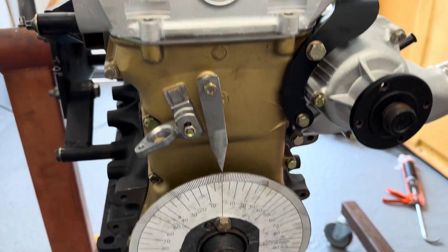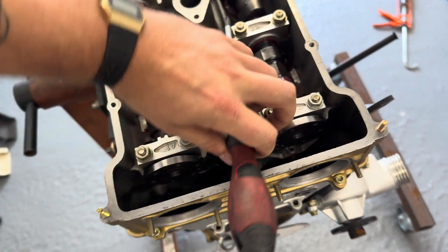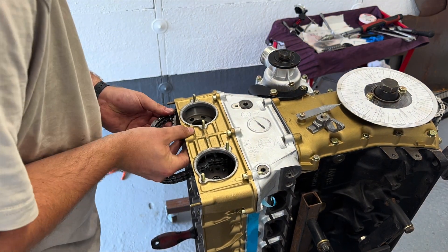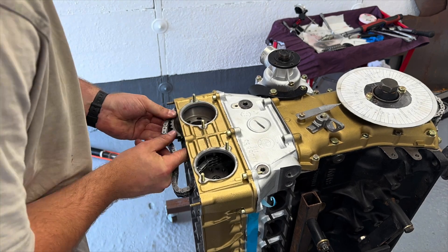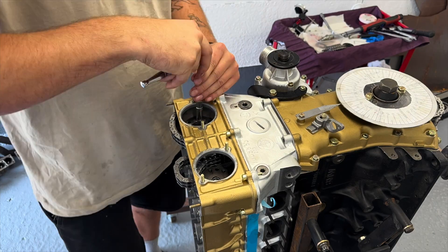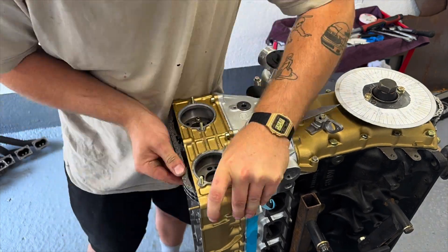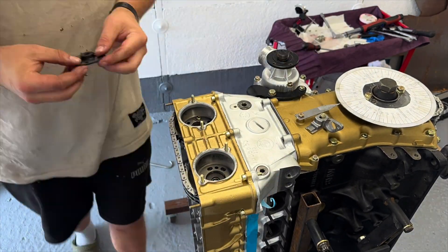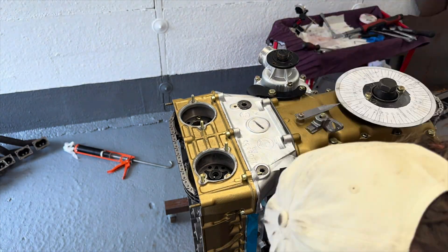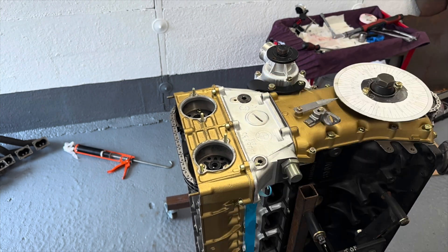When I was doing the PTV checks I did mark the cams in their top dead center position, so I put them back to where they were and then double checked the valve lift at TDC. The next task is to put the sprockets on — this is pretty tricky. You want to install the intake first while applying as much tension as possible onto the chain, which sets it correctly, then you can put the bolts in. If you have too much slack at the bottom it will jump a tooth and it's an absolute pain. Align those up to the original marks — all worked out well. Then we have the chain tensioner; this is the S50 chain tensioner with a little fork on the end, so I lined up that fork and slotted it in.